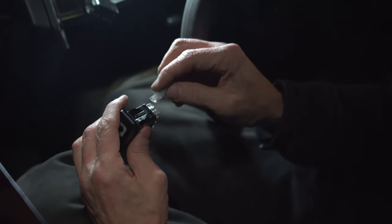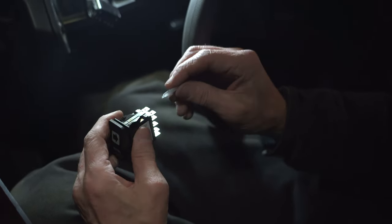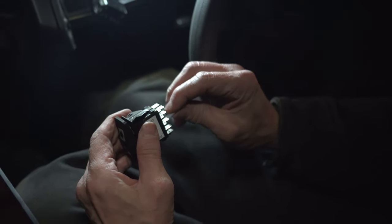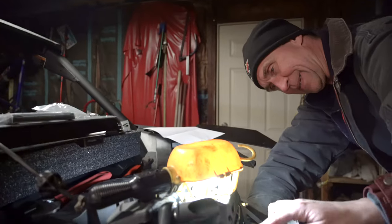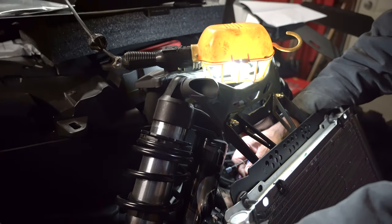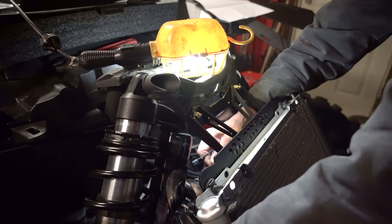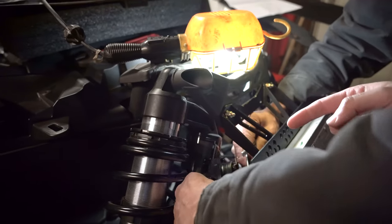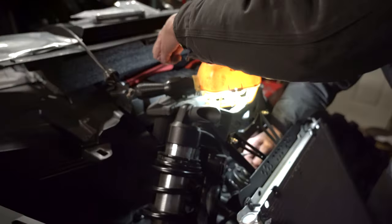Corbin Custom Works supplies some dielectric grease so we can put that on the terminals on the switch connectors. At this point we are almost done installing the street legal kit — we're going to be installing the horn next. We have a different radiator support from Fast Lab UTV, which already came with holes pre-drilled in the front, so we're going to mount the horn there. If you have the original plastic fan shroud, you will have to drill a quarter-inch hole in the upper radiator support, as shown in the instructions. We've got a black wire and a blue wire to connect to the horn.